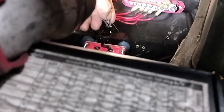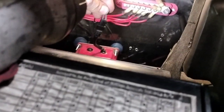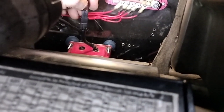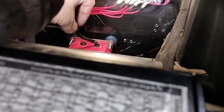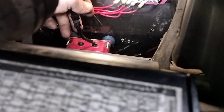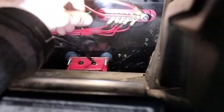The new box actually came with the correct pigtail for the distributor — the other one I had didn't have this connector. I kept this from the distributor, so this is orange and purple coming out of the distributor, which I've determined is correct. The colors coming out of the distributor are a little different, but it's just a matter of polarity at that point, so I just need to go orange to orange, purple to purple, and make sure the polarity is correct.